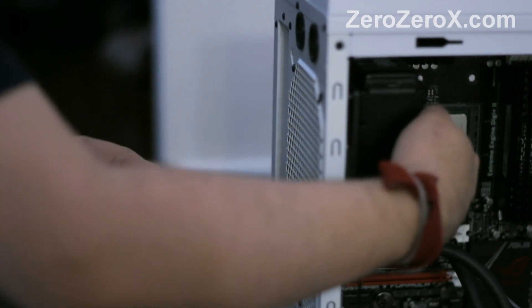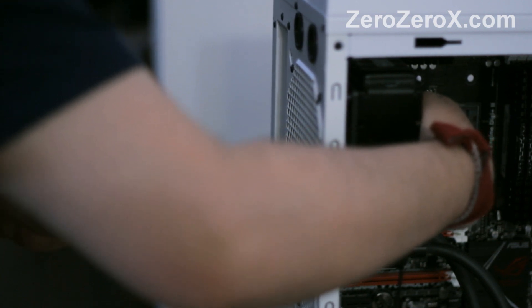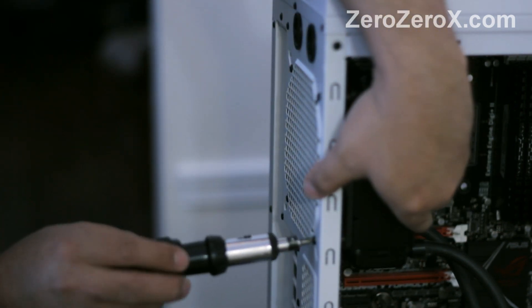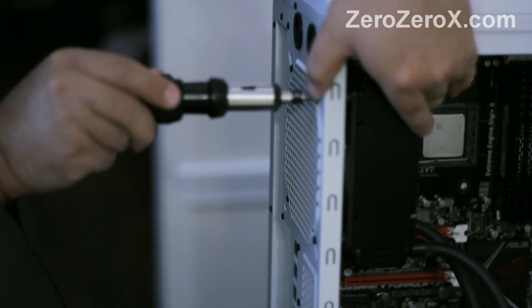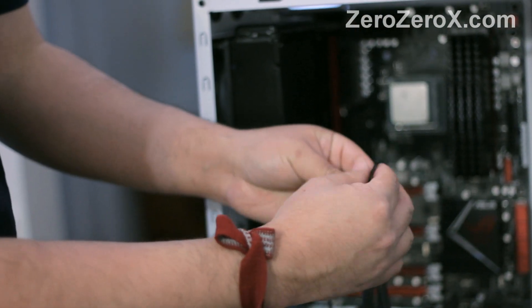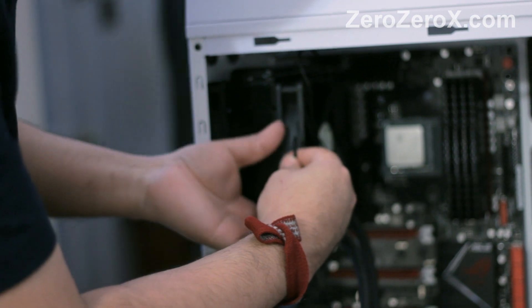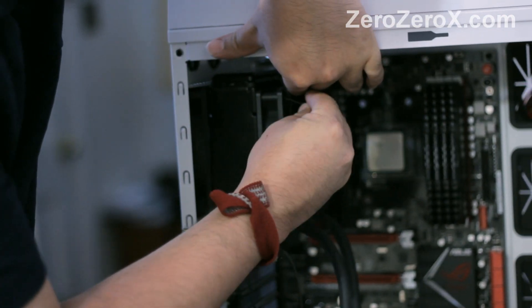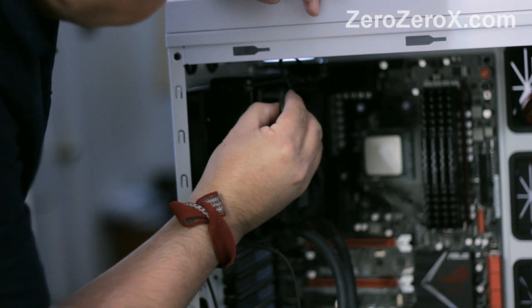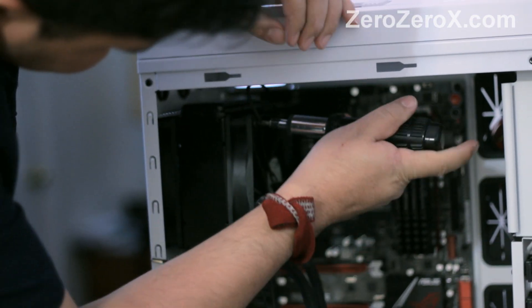Okay, that's the last screw — now we're ready to install the second fan, which is also going to be pulling that air inside the case towards the 200mm fan on top. Let's just tighten it up a little bit, and now we're going to use the washers on this one. The fans go in the same direction, pulling or pushing the air the same way. Hold the fan to the radiator and put the screws in so that all three are attached together.